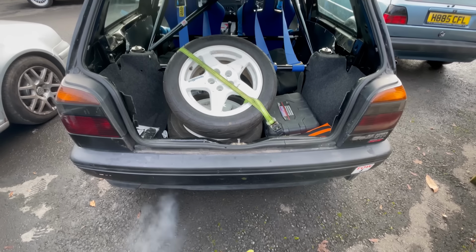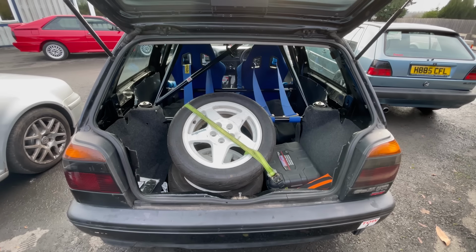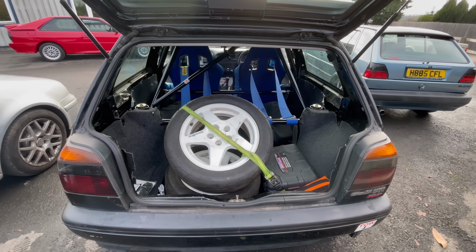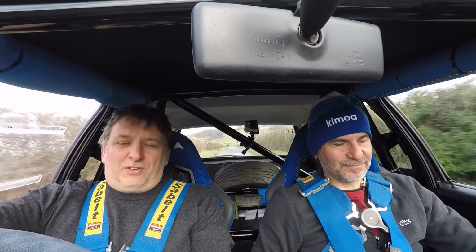It's all skidded underneath, so engine guard, fuel tank guard. The exhaust is tucked right up into the body, because some of the road rallying will take you into farmyards and farm tracks, and the idea is to come out the other side of them in one piece, with an operating car. And bizarrely, the latest event we did, we were 94 miles into 100 miles, and the water pump pulley bolts fell out and finished our rally for us. Apart from that, the car was absolutely faultless.